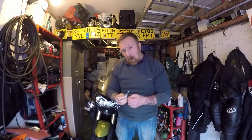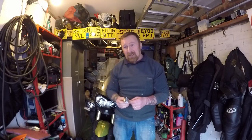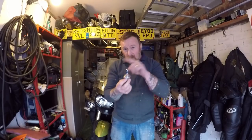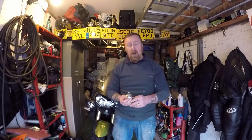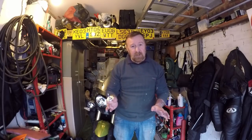Now, if you're riding a moped, check the bulbs first. A lot of mopeds actually have 35-watt bulbs. Peugeot Speedfights, these are 35-watt. And some of the old dome bulbs are also 35-watt. And the problem with them is it's not good to upgrade them. With 35 watt, a lot of people stick in 55, 60 watt bulbs, just whack them in there. They're still not very bright, and they wonder why it does mess around with your bike. The little stator coil hasn't the power, but let's move away from little peds for the time being.